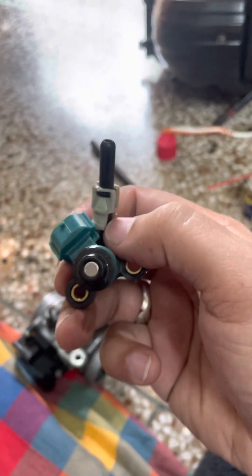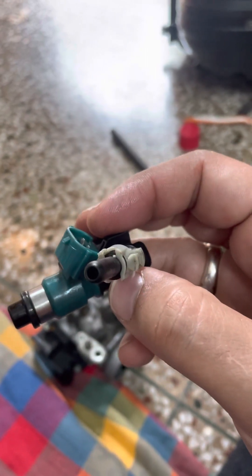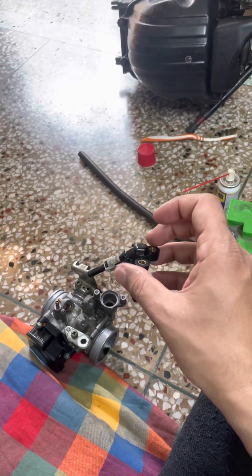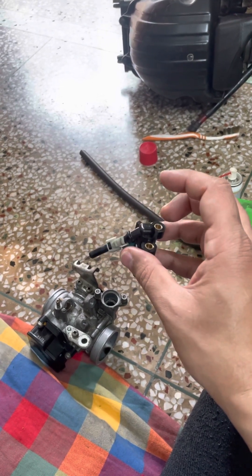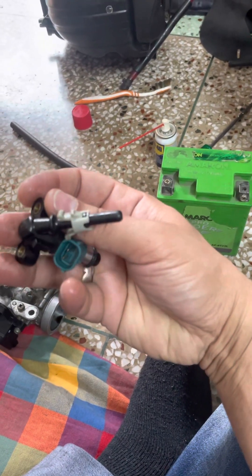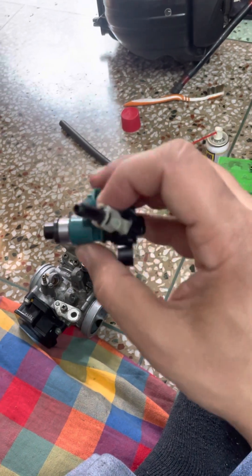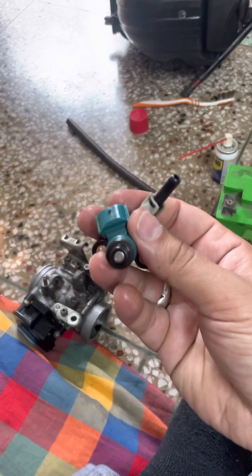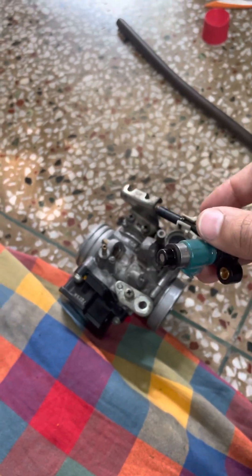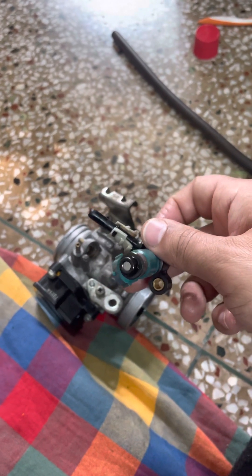This is how you open it. I hope you like it. I'll try to clean it now, which I'll show in another video. You can see all the dirt accumulated at the side. We will spray WD-40 inside the inlet petrol pipe and push it through by connecting it with the battery terminals so that it opens the valve while we're pressuring the WD-40 inside. Hopefully it will get clean. Do subscribe for more updates — thank you so much, please leave a comment if you have any doubts.